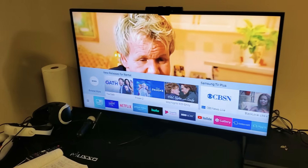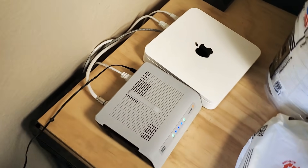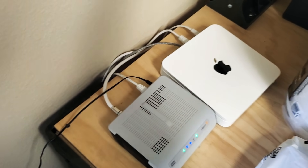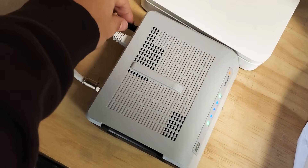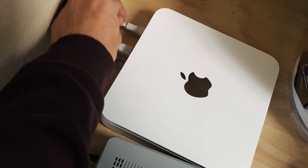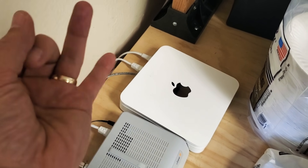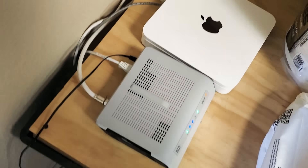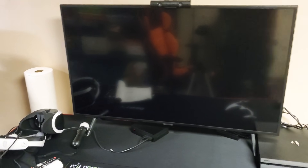For the third option, go ahead and unplug your TV from the socket. Next, walk to your modem and router — some of you may have them as one combined device, but mine are separate. Simply unplug the modem and unplug the router, so you have the modem, the router, and the TV all unplugged. Wait one minute, then plug in your modem and router and plug your TV back in. Start up your TV, and you may want to wait three to five minutes until your Wi-Fi network connects again.